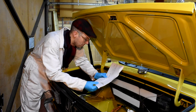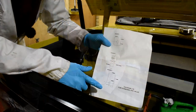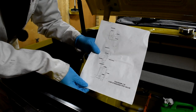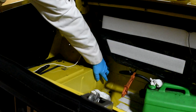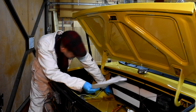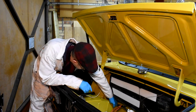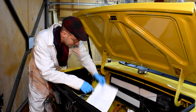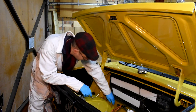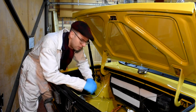We've got to the point of actually installing the new fuel pump now. Just following the instructions that come with the new pump from TRGB — they're really nice and clear about where you need to drill the holes for the actual pipes that come from the fuel tank down to the fuel filter, and from the fuel filter back up to the PRV T-piece. I've just done a little pilot hole where it tells me on each side, and now I'm just going to bore it out to the right size and then feed the pipes down to the right places.